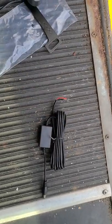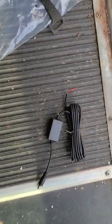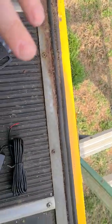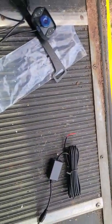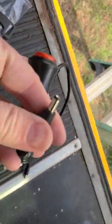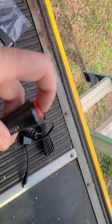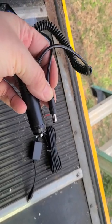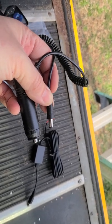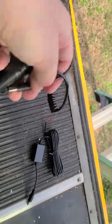If you're running it as a backup camera, you tie the power wire into your reverse lights — when they come on, it triggers the camera to come on and show an image on the monitor. However, if you turn the cable the other way and run power from the front of the bus using this cigarette lighter adapter, you can run it as a full-time reverse camera. This little button is your power button. I didn't know it had this dual functionality when I bought it, but it's going to help a lot with how I wire it.